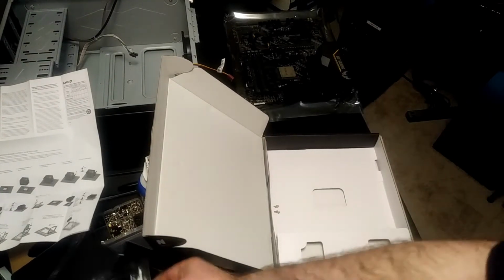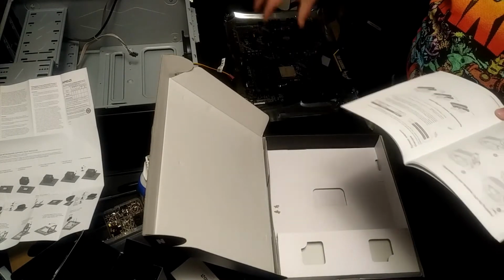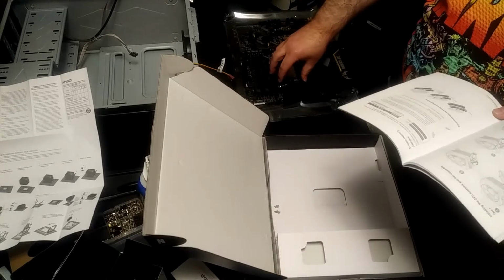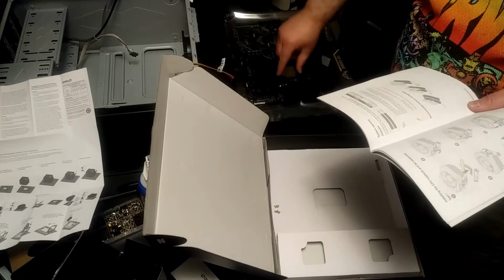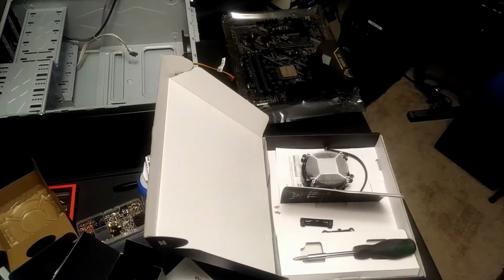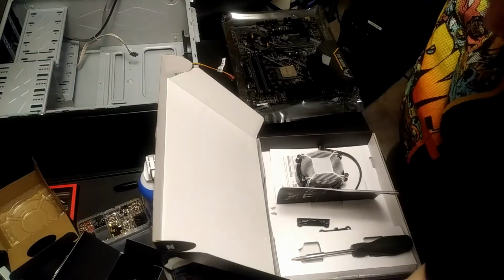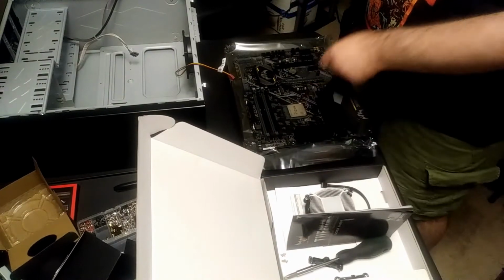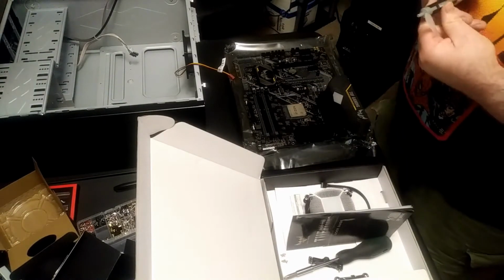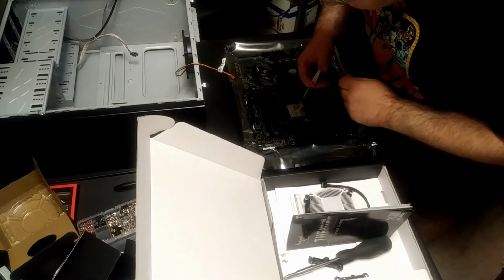And then the next bit is you got to put some thermal paste here. And then we put the cooling fan over the top here. I might actually have to remove these before we do that. Okay, I know it's up on the high part of the screen here. Let me make a little bit of room, bring this in a little bit more. So, that's the processor. Here's the thermal paste. And I'm just going to squeeze it on. And that looks about good.